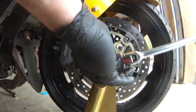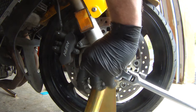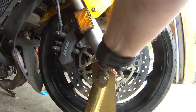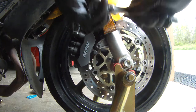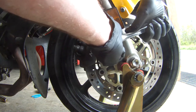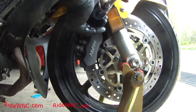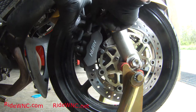Thanks for watching. Today I'm going to remove and rebalance my front wheel. First thing we're going to do is loosen the 22 millimeter axle bolt on the right side of the motorcycle. I haven't ridden this bike a whole lot lately — it kind of sits parked. I took it out for a ride and at about a hundred I had a really bad shake in the front end, and I was thinking that maybe the front tire was flat spotted because it sat for so long.